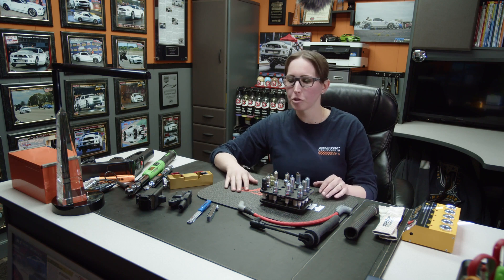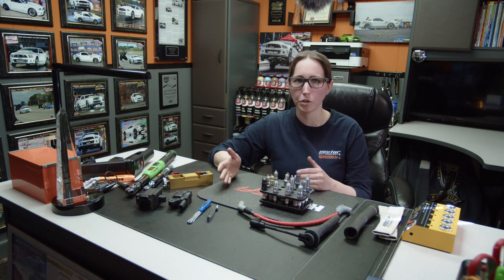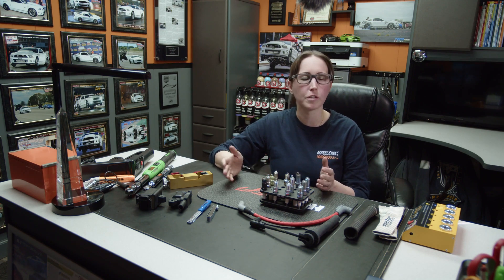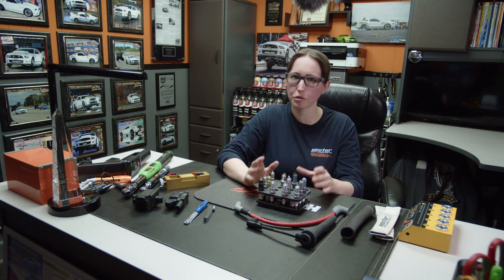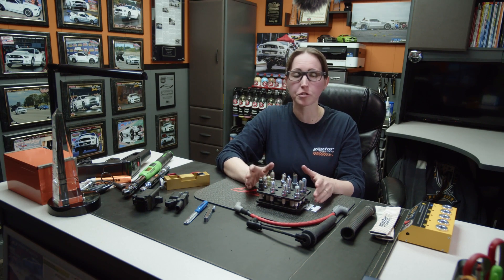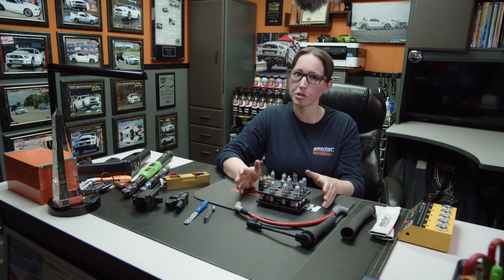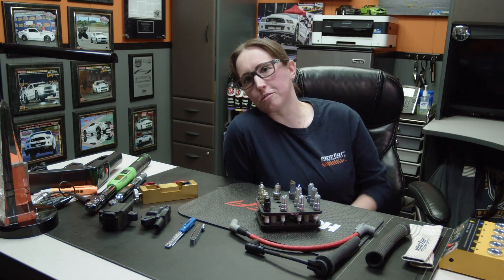Overall, that's pretty much it when it comes to ignition and spark plugs. Most shops will be able to tell you everything you need to know. Make sure all your wires are grounded, your coils are good, and your wires are in good shape — it saves time on the dyno and money at the end of the day. In conclusion: make sure you have the right plugs, proper gap, proper heat range, and proper gasket versus taper. It'll save you time and money on the dyno and potentially your motor. If you have any questions, reach out to your shop or tuner. On the next episode we'll be talking about fuel injectors and fuel systems. This is Sam, out.